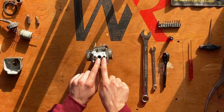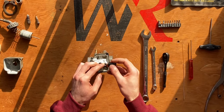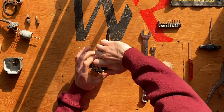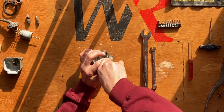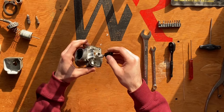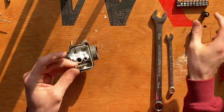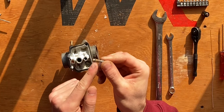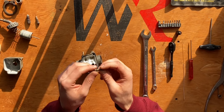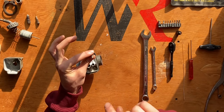We have one more jet in this area for our idle. I'll use the flathead bit for the quarter inch drive so I don't damage the jet. I'll loosen it off, then thread it out by hand. On this jet something very interesting — it has an o-ring, so you want to make sure the o-ring comes out with it. This jet has four bores around the perimeter and one bore going all the way through. You should be able to see through it; if not, it's clogged and will affect idle.